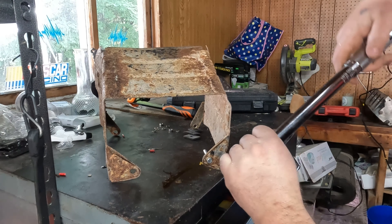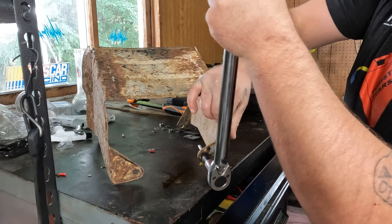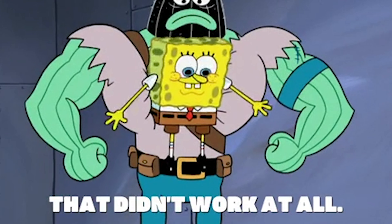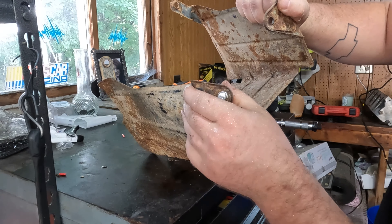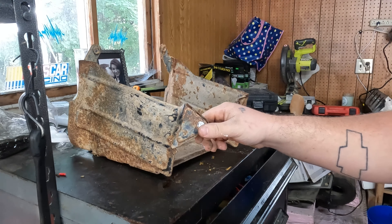I think this metal might be a little too thin — we're going to keep trying. That broke. Bend this a little back, but then you can see it's in there. Now whatever you needed to bolt up — so for instance, my radiator on my Mercury bolts up to the frame, but the threads were all stripped out. So I was able to drill the hole bigger and then throw in a rivet nut, and that way I could bolt my radiator to the car.